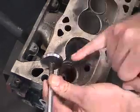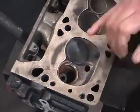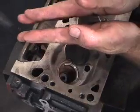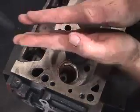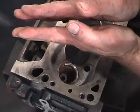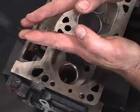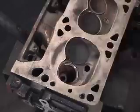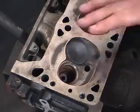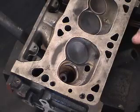What we want to do is the valve face and the valve seat have to be matched and equal on planes. If we had a concentric angle, both these planes would be on the same angle and the exact same distance apart. If we had an unconcentric angle, we would have a difference in the angles, creating an unconcentric condition. Most manufacturers allow anywhere from 3 to 5 thou of an unconcentric angle, and that's based on overall concentricity between those two planes.